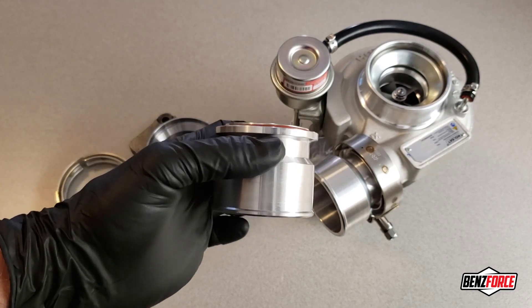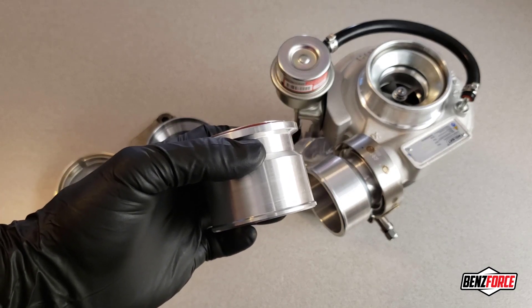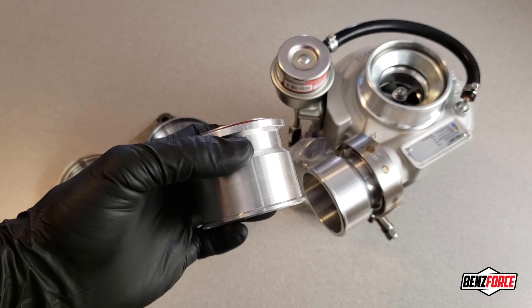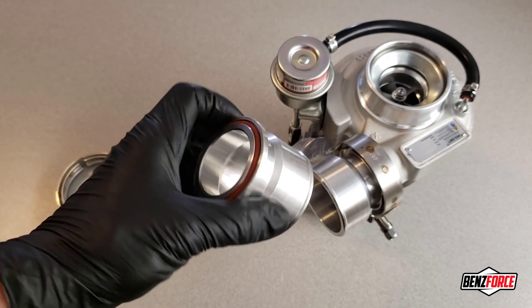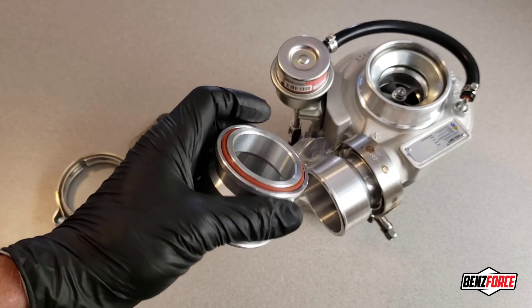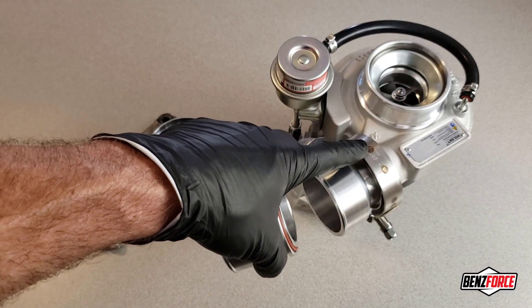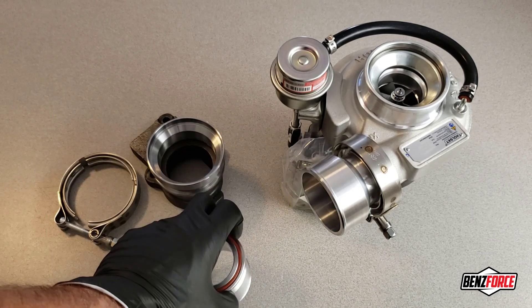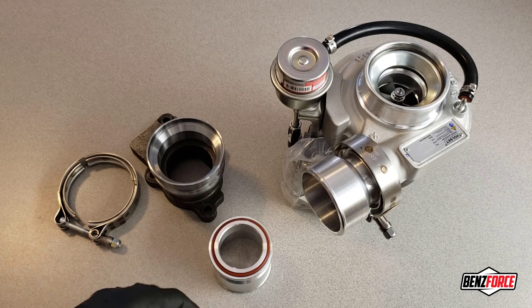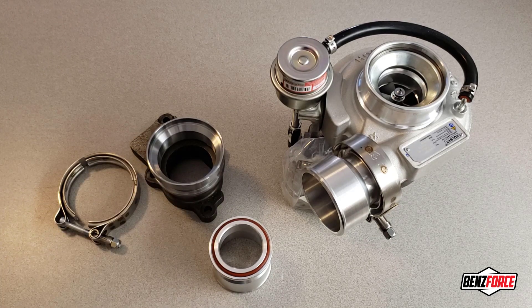This will give a good tight seal, and it's available for the HE221, the HX30, and we're having them made for the HX35, which happens to be the same size as the HE351. When you get these aluminum adapters, not only will it come with the O-ring, but it will also come with the correct size compressor clamp. It's really an incredible value. Combined, both of these things will make fabrication time much quicker and will end in a much higher quality result. Thanks for watching.